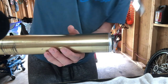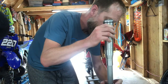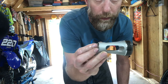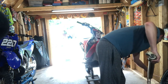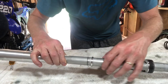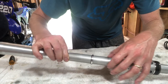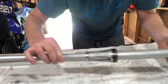Now you can go ahead and loosen up your top fork cap. You can now go ahead and pull out the inner cartridge. There's a washer or bushing that comes out next, and then the spring. Just so you don't get things mixed up — this is how the piece assembly goes: you've got the bright metal washer/bushing, then a thinner dark washer, and then the cone piece. That's how that goes.